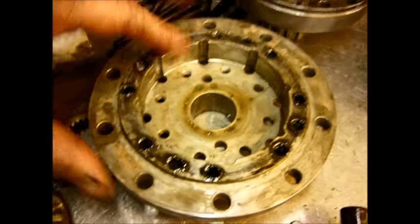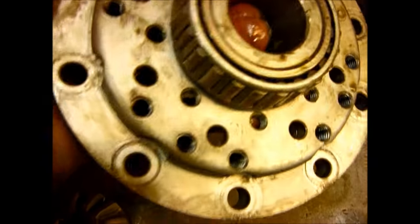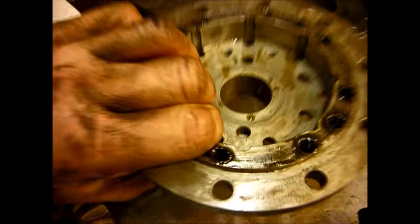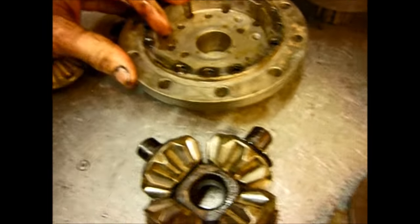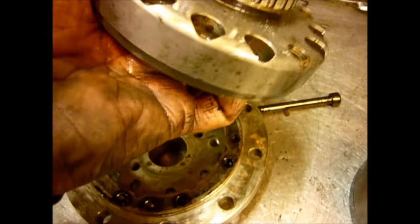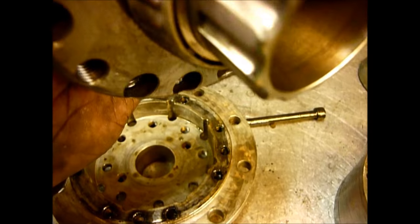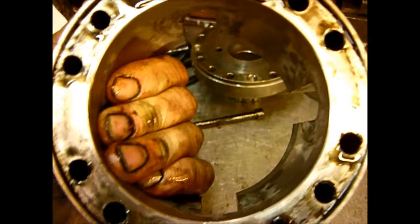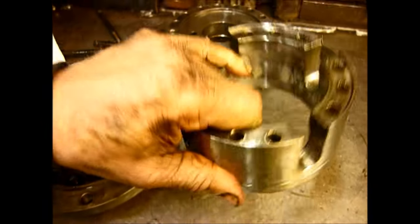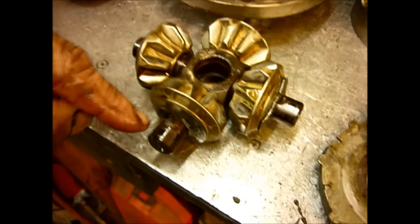This is the end flange with a normal RTC 3095 seal. There are many different threaded holes on these because they cater for a selection of different configurations — you can have a locker or a limited slip locker. This is the other end flange which has the special bearing on it. It isn't in the best health so it will be getting a new one. The centre tube itself is just a simple tube with bolt holes going all the way through, plus slots for the four-pin that holds the gears.